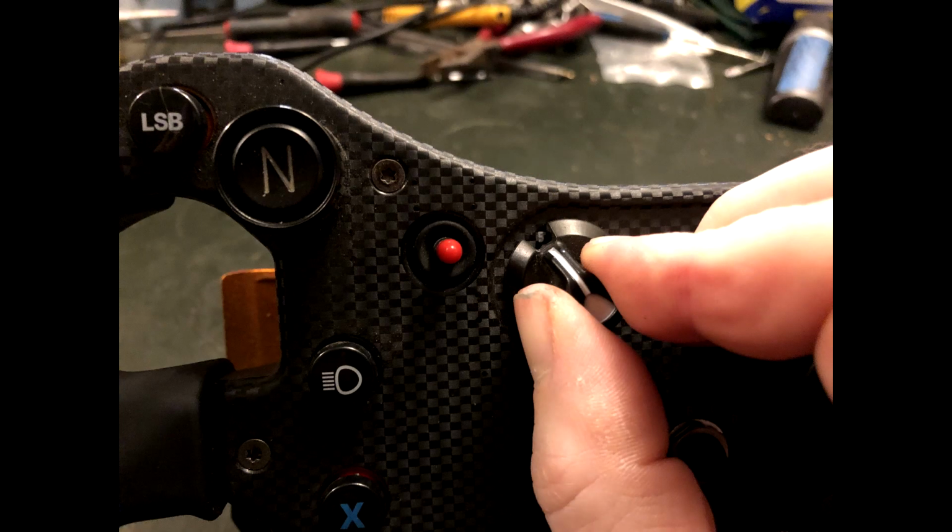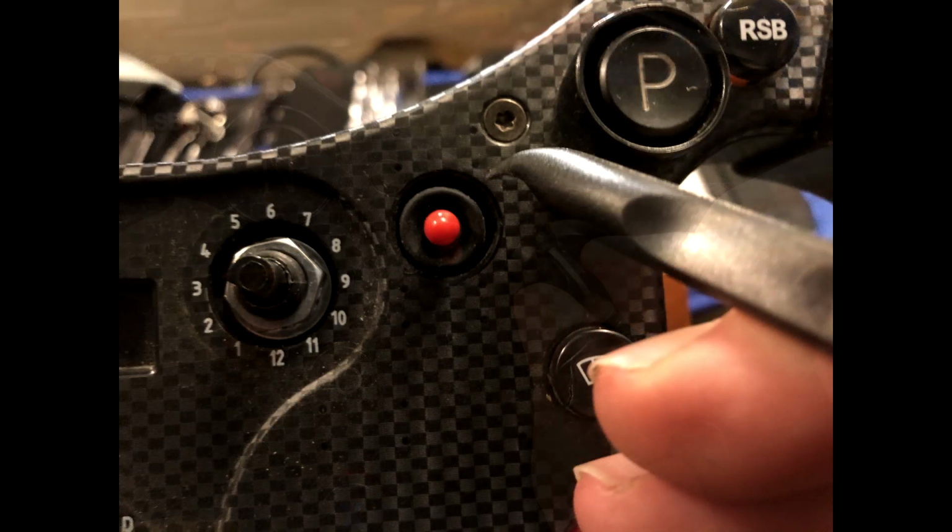First up, on the front of the wheel, we need to remove the 3 knobs, 2 multi-position ones and the mode switch below and between them. These come off just by gripping hard and pulling straight. I set them all in the same orientation so it was easy to see which way they had to point to push them back on later.